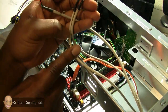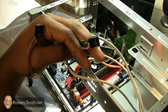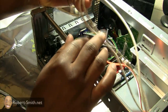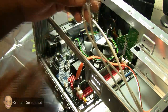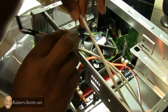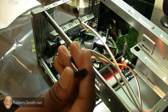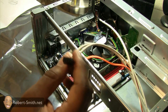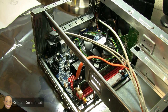Next, I'm going to take the connections from the front of the computer case and hook those up to the motherboard — things like the USB connection, headphone jack, and microphone jack. Sometimes people get confused about which cable is which, but this one actually has 'USB' labeled on the cord. Some cables have stickers, and this one has a missing pin so it's hard to hook up wrong. Analyze what you have, check your motherboard, and if you can't figure it out, the manual will tell you.